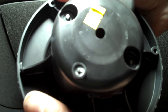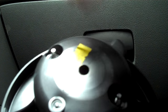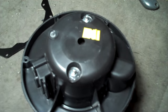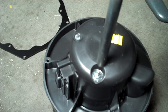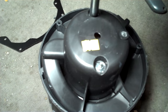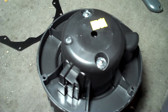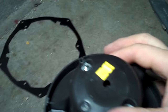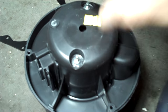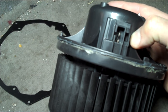Squeeze it back down, the bolts pop right through. Put the nuts back on the little studs, tighten them down, and we'll be ready to reinstall. Now the last step in reassembly before we put it in the dash — I've got those two nuts on the studs tightened down. Double check and make sure that your wiring plugs are lined up properly inside here. I need to continue finishing tightening this down and make sure those plugs are sitting in the right location. Otherwise you're not done — you want those snugged all the way up, otherwise the plug won't go together.